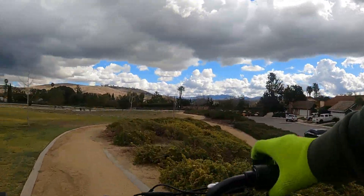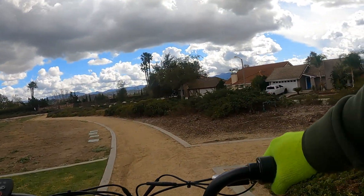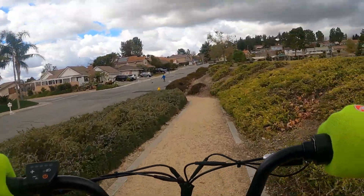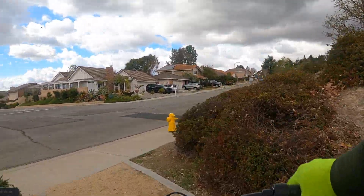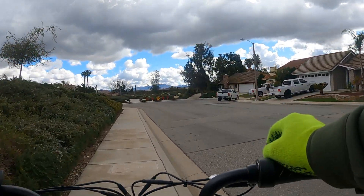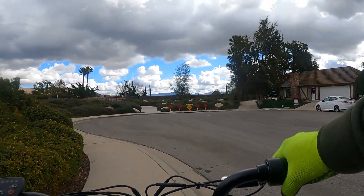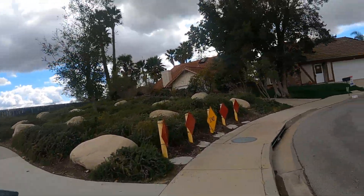Pretty decent brakes — no problem there. With a lot of these bikes when you get it out of the box the brakes aren't the best adjusted. Just look up a YouTube video — it's really pretty easy. Loosen the little bolt that holds the brake cable, pull the cable through a little bit tighter and that gives you more resistance at the handle. A lot of times you pull the brake handle halfway and there's no resistance, which means you've got to tighten the brake cable.